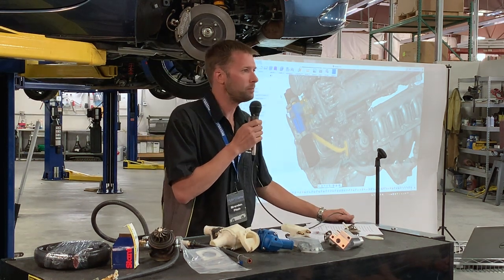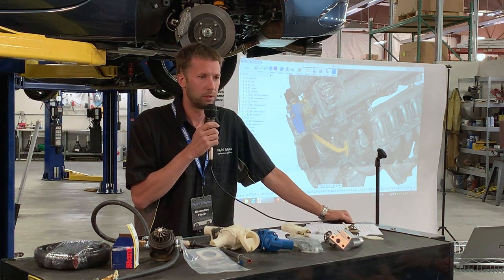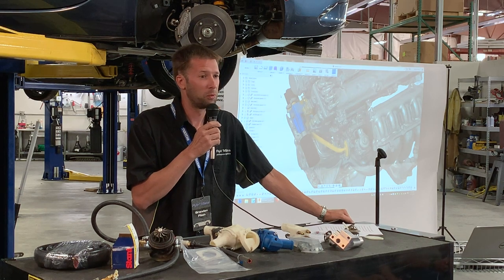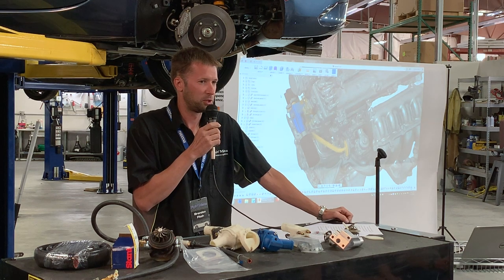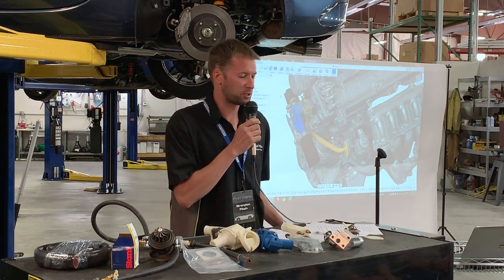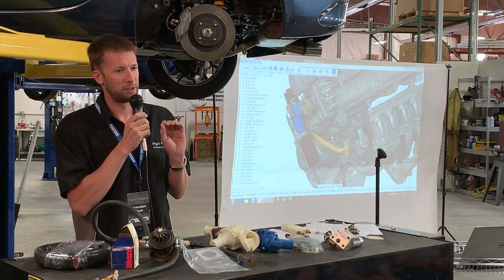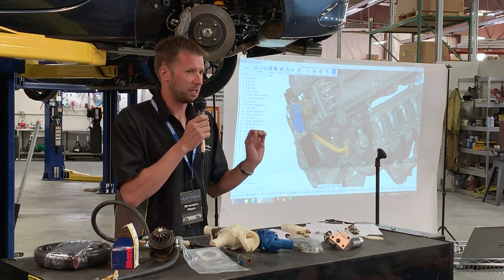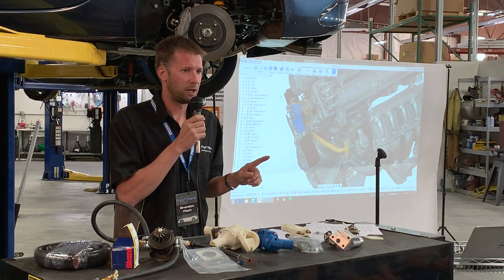So, more questions? Yes? I only heard 8% better flow than the stock, and to me it didn't translate to $300 worth. So help me, what were the overall net cooling efficiencies that you achieved? Sure. So basically he's asking, 8% is not very much, why do I want to spend $300 on it? That's 8% in flow area. That doesn't take into account where the coolant is going. That doesn't take into account how the turbo water is routing, and that type of thing.